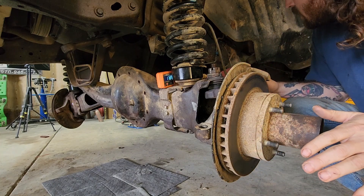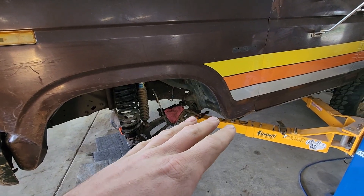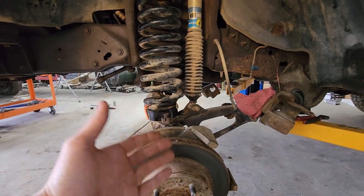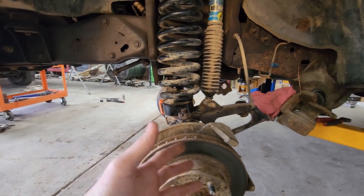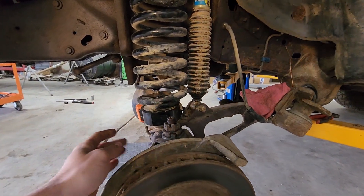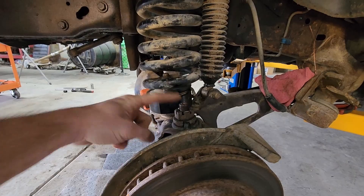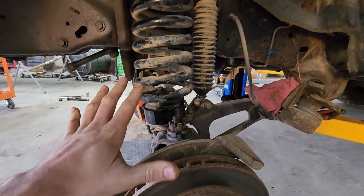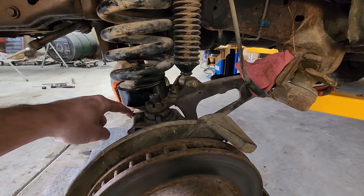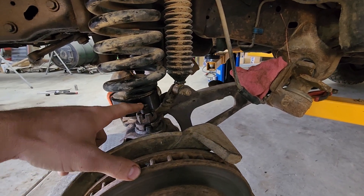How I'm going to do that? Still figuring that out. If my theory is correct — because I've searched every forum, website, and video I can find — people say, well, just measure the caster. And I'm like, what's an easy way in your own garage or driveway to measure caster? The way I'm thinking: this coil is obviously sprung forward. This mount technically should be zero. This top ball joint is off-centered to the rear, which means everything from the factory should be set with these radius arms flat. If I set the coil bucket at zero, this should be pretty close to factory.